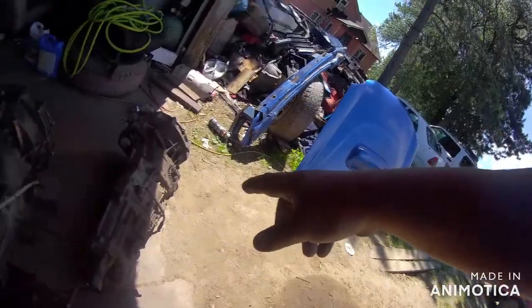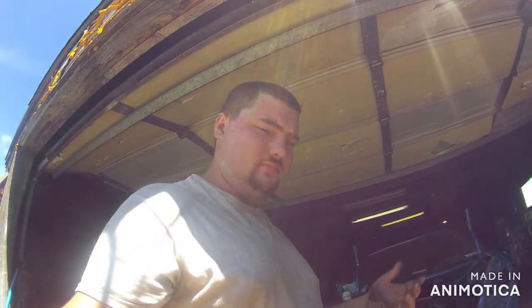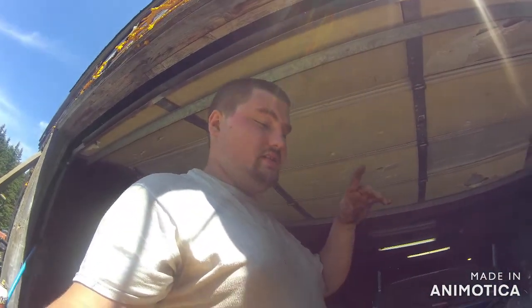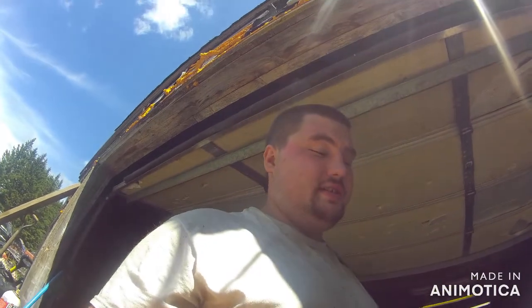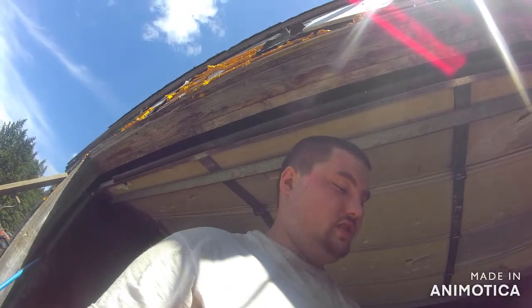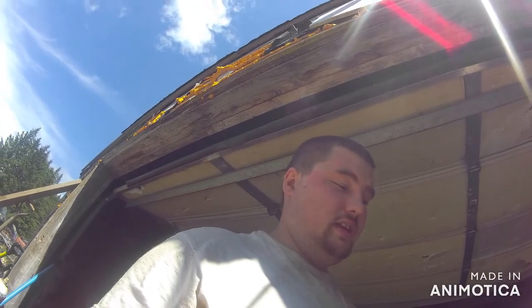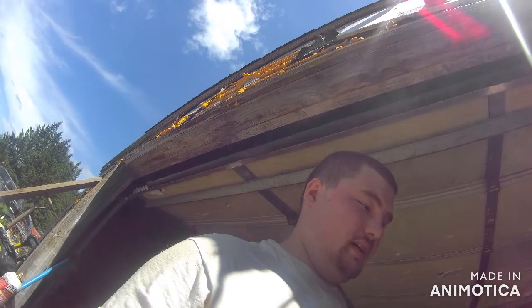Future plan is we are gonna take the good gears out of this transmission here on the floor, and we're gonna put them in John's transmission that's in his WRX, because those gears are shot now because he dynoed it, but it's still got a good center diff. So we're going to take the good center diff, swap all the internals, the actual gear housing of the transmission, to the other one, and then put the good center diff back on, and we're going to have a backup tranny. So that's going to be cool.